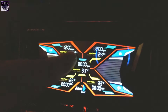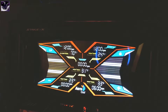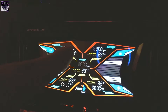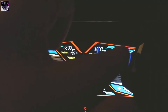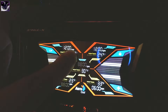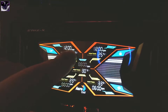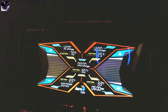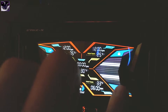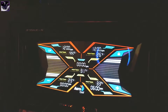So if the alarm is set to 70, and the current temperature goes over 70 degrees, then fan number two automatically goes to maximum. To change the alarm, first unlock the device, then hold down the temperature button for three seconds — it beeps and starts blinking. Then you can change the alarm temperature. I'll leave it on 70. Click again, and that's it — it's set.